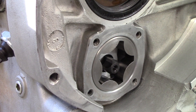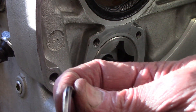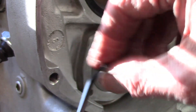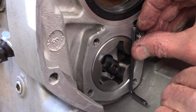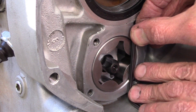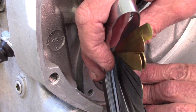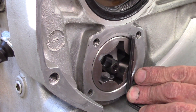I find that if I use an Allen wrench, there's a flat face right along the edge of the wrench which lines right up with the foot. What I do is lay the wrench with the foot pointing straight out right across the block and across the rotor, and then slide a feeler gauge in between the rotor and the flat spot on that Allen wrench. That's how I get a measurement on the outer rotor end play.